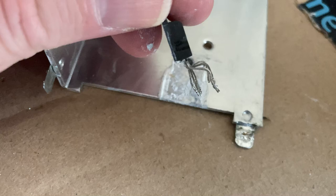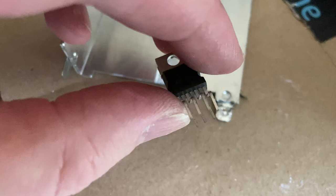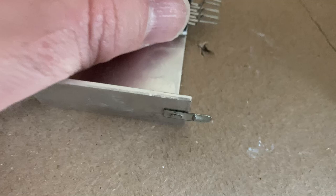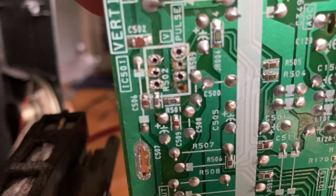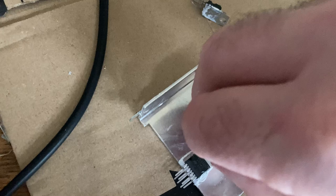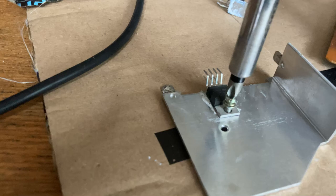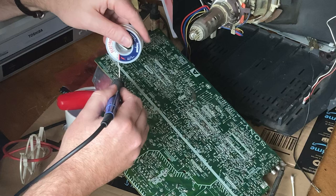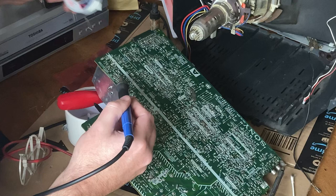This is the vertical sync IC chip — the offending article. Take the new one, put a bit of thermal paste on the back, then put it all back together and hopefully have a working unit. Nine times out of ten it will be this area of the board. To replace it you have to disconnect all the heat shield, the RF shield, and the heat sink. Desolder both the shield and the IC itself from the bottom of the board, then clean and remove it. You can see the old one is all knackered and bent from heavy use.